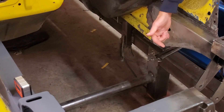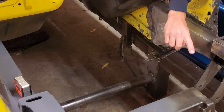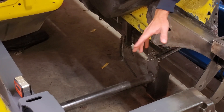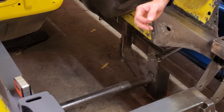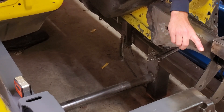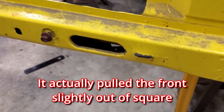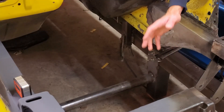I did find other measurements where you could measure off the front cross member or the bottom of the radiator support, but that's not always a good idea — especially on this car. It looks like someone pulled this car with a chain at one time and it bulged out the front of the cross member, so I cannot use that for reliable measurements.